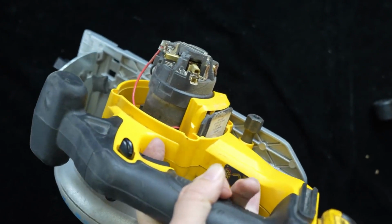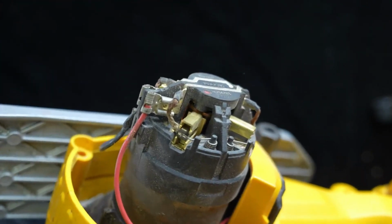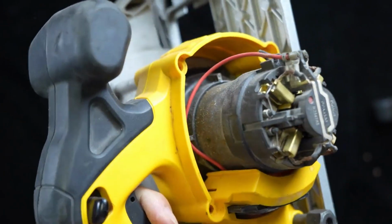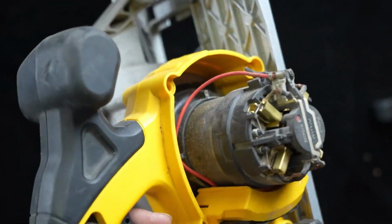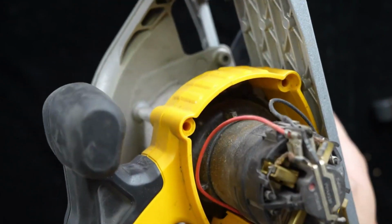There has to be sparks. Let's plug it in and have a look. As this is an integrated motor, it doesn't fear not being able to communicate. Let's give it a try. There shouldn't be any major problems. Can you see this bright object? This is a spark from the carbon brush as it makes contact with the motor and rotates to create a conductive spark. This is a brushed motor. This 391 possibly is an old design as it possesses a brushed motor.